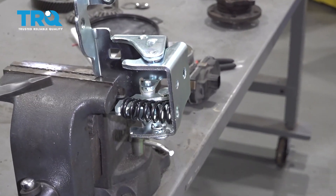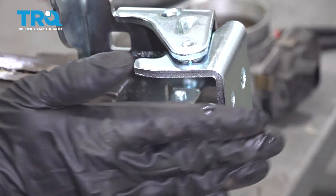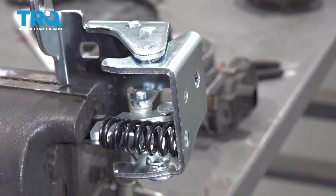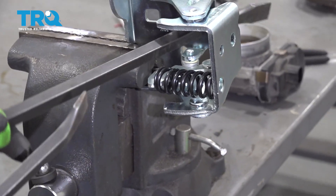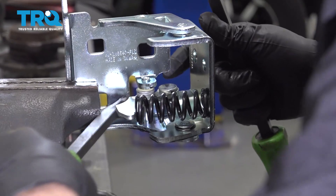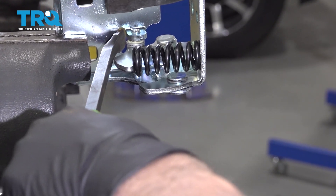Very carefully, you wanna put this in a vise to install it the way we removed the old one. We want this part of the hinge to be over here and the spring will be compressed. Do not grab this with your hands — you don't wanna squish your fingers. Be very careful. You want to use a pry bar or a couple of pry bars and pry this out. If you have one of those spring compressors specifically made for this, the door spring compressors, use that — that would be ideal. But if you don't, just do it this way. Just be careful.